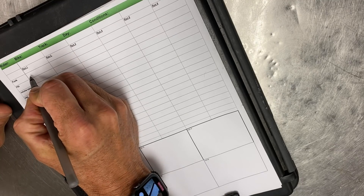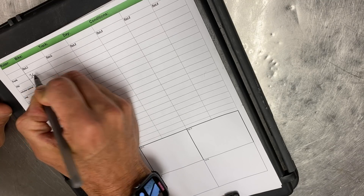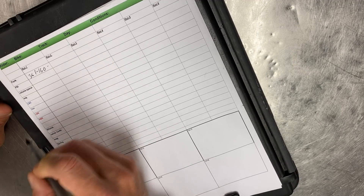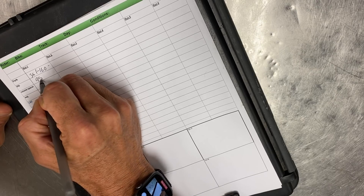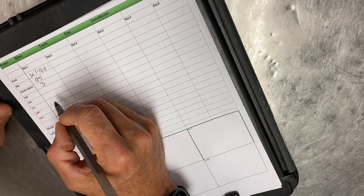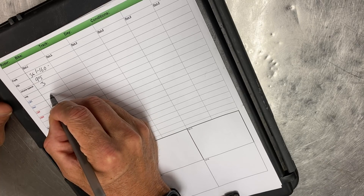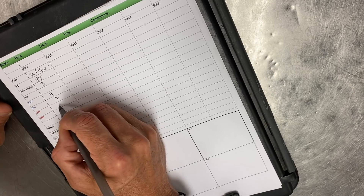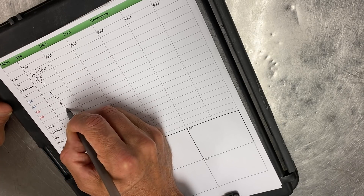So you start with pressure, check your sag, and write it down. On this bike I'm running a Fox 36, 160mm. I have 95 PSI and three volume spacers. My low-speed compression is 9, high-speed compression is 7, low-speed rebound is 6, high-speed rebound is 5.